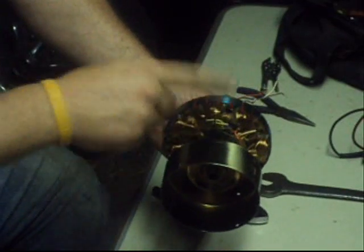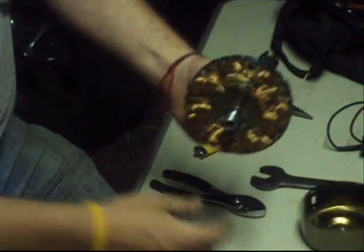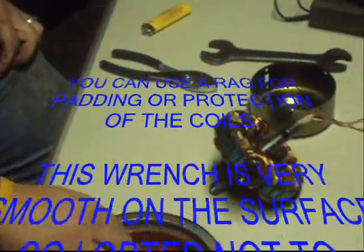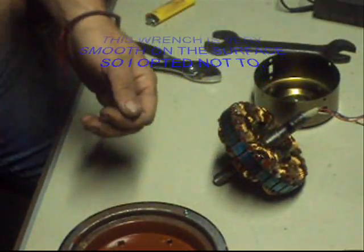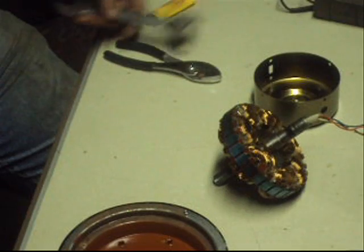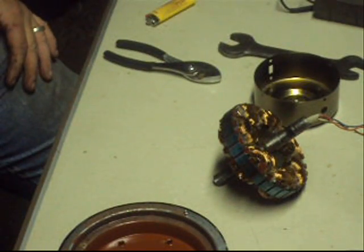Messing with these wires over here by pulling them out and sticking them back in — I've done that on a few of them. I really don't see it necessary when you can swap the plates. If the bearings don't come out, now you know how to get the bearing off. Don't be hitting it too hard — we don't want to mess your coils up. Just keep tapping, be patient, let the vibration do the work. That's how an impact wrench works. Now you've seen your redneck bearing puller. I'm Scott Brown with Green Wind, another home energy.